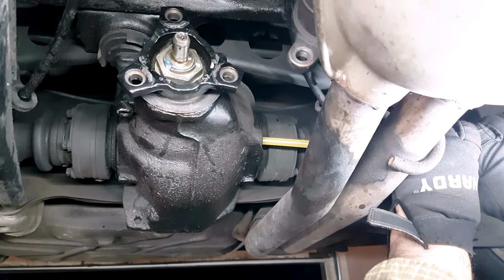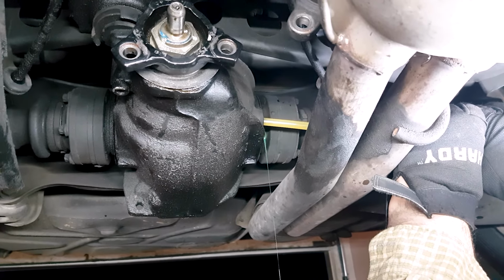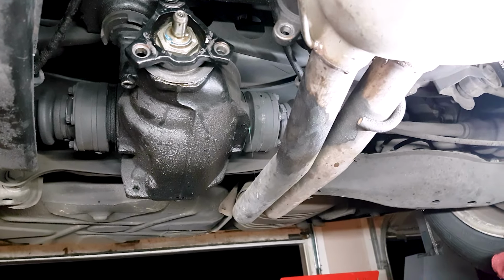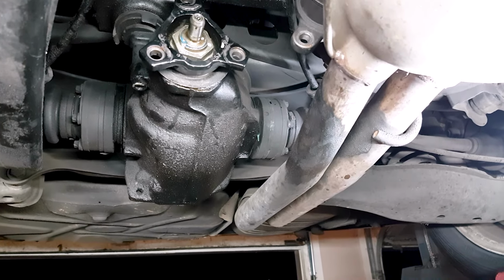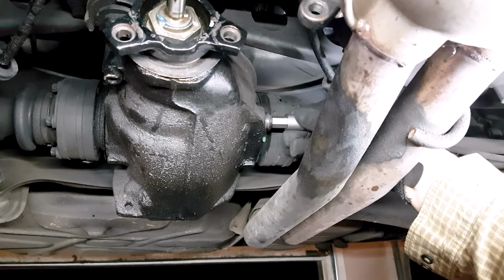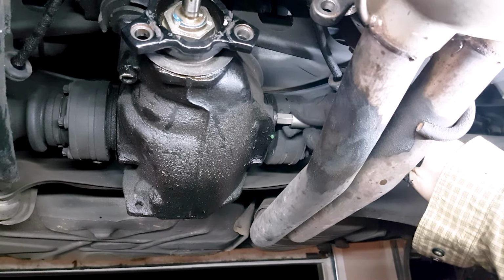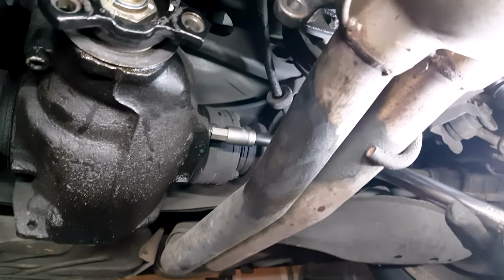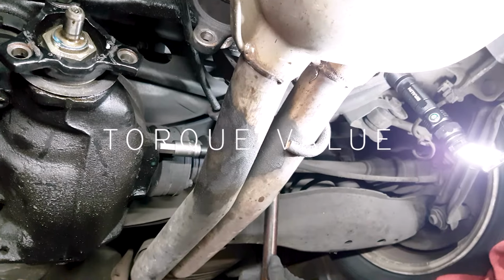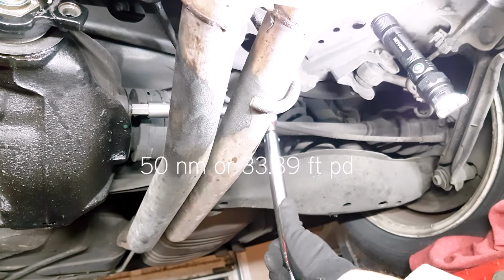As you notice, my marking on the collar nut is just a little lower than the one to the right of it. So it probably wasn't torqued properly last time. And that's okay. And so at least I know it's very close to where it was. Because there's a crush washer inside, and if you torque it any more than that, then you could crush it further, and then the distances, of course, between the gears, the pinion gear and the others, would change, and that would cause your differential to go kaput.